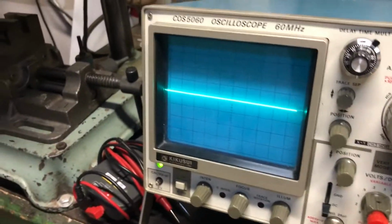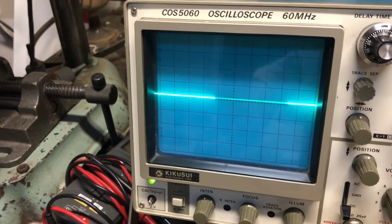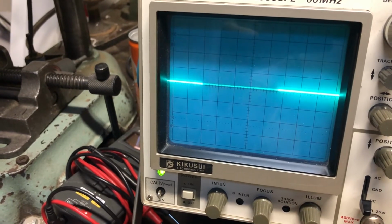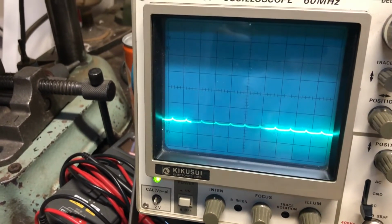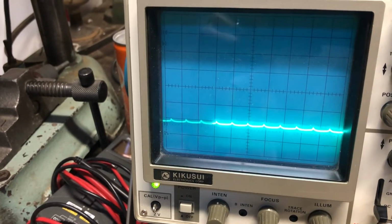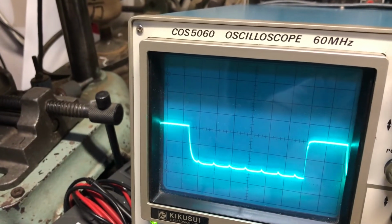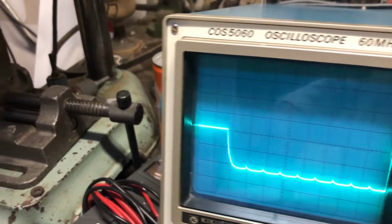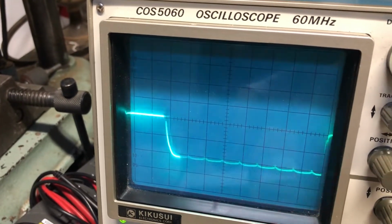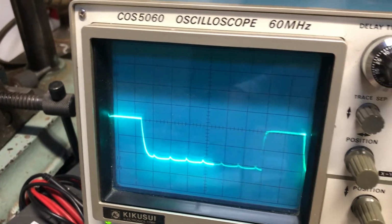Okay, if I turn this on, that's with the points closed. That's with the points open, closed. So open is basically 0 volts, closed is negative almost 12, no 10. 510, yeah, that's about right. For the resistances involved, that should be exactly right. But you'll notice that when I run this, I set up a nice square wave as that goes, but you don't see any high voltage spikes. So it appears that that voltage spike certainly does not come from this capacitor, which is reasonable.